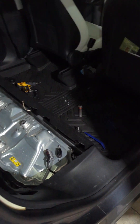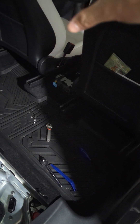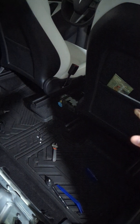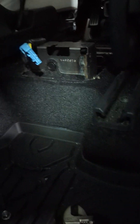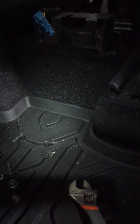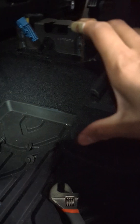So you will see six 10mm fasteners total — three nuts with washers that are from the actual RCM module itself. On a Model 3, after removing those, you can just lift up the entire center console because the bottom of the center console flushes with the floor. For Model Y, the tricky part is there's actually a couple of inches of height difference, so you actually need to remove the center console fully.